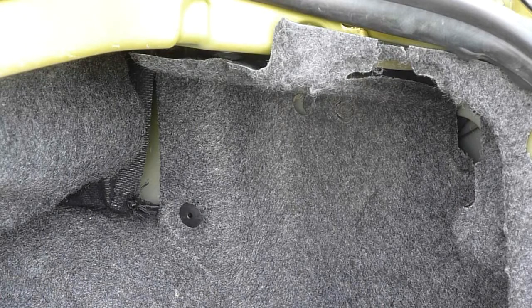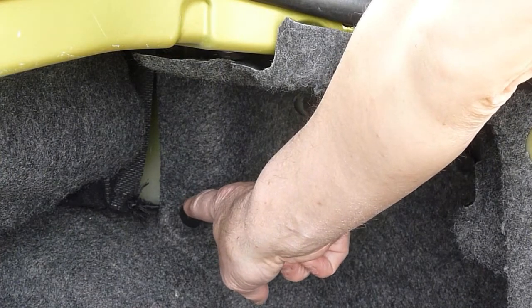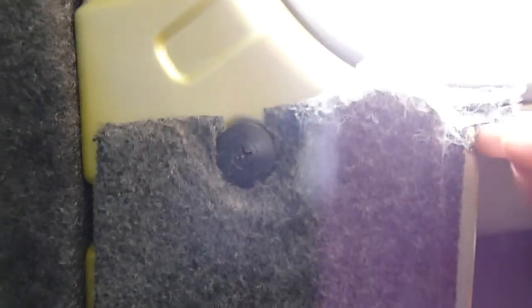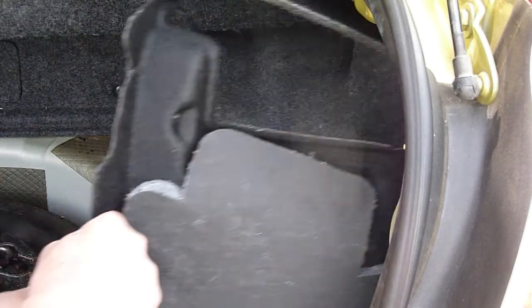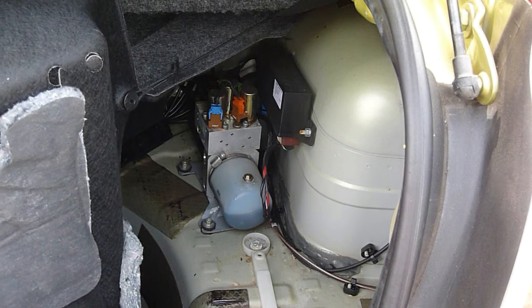You'll also notice there's another clip inside the boot — do not attempt to remove this. It's an anchor point for an elasticated strap that helps keep everything in place. Finally there's one more clip tucked up underneath; that won't need to be removed, you just pop the lining out from beneath it. You're now in a position where you can prise the lining out to one side and there you can see the actual reservoir.